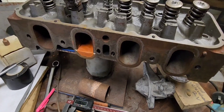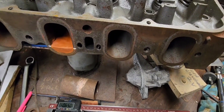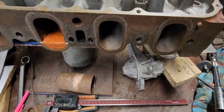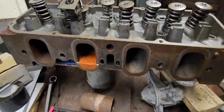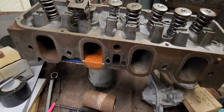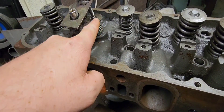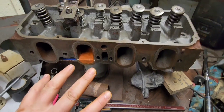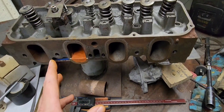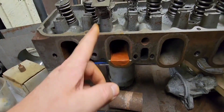Port back on the bench. Done some preliminary testing and it's quite interesting — in fact, I'm wrong. I'll turn on the bench and you can see why I'm wrong. The important note is the valve is back to where it was, which is 0.65 inch lift, and the only change for the comparison is the clay on the bottom filling the bottom of the port as you saw before. So I'll turn on the bench and you can see the flow number.